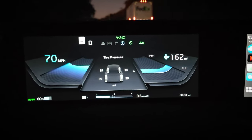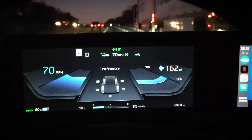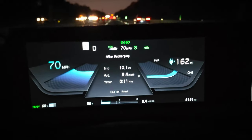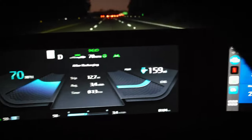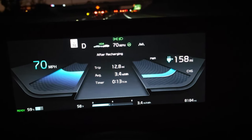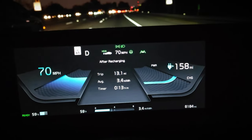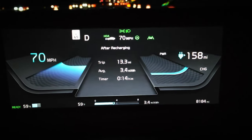Coming up on 10 miles and we're still at 3.6 miles per kilowatt hour, which is really solid. Tire pressures have crept up slightly but are still right around 38 to 39 PSI. Now coming up this hill we're showing 3.4 miles per kilowatt hour. Nearing the end and we're still at 3.4 miles per kilowatt hour at 70 miles per hour with these Titan 7 wheels, which is just awesome. The BMS state of charge is at 59.5 percent. That's only 0.1 miles per kilowatt hour lower than the factory wheels, which is incredible considering how aerodynamic the factory wheels are compared to these. That equates to only around 7 miles less range per charge.